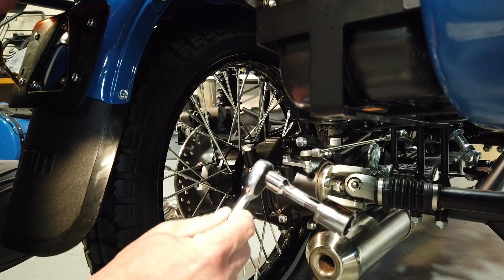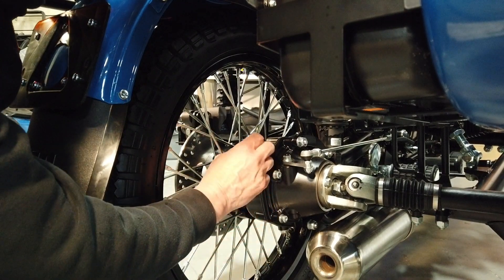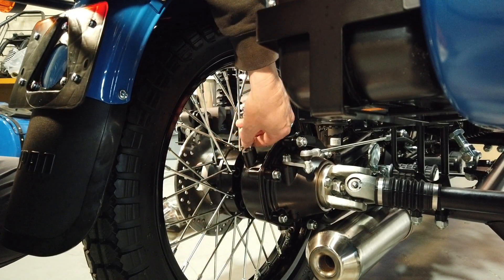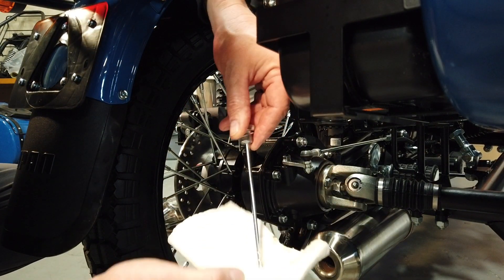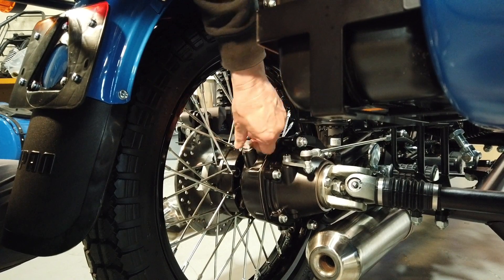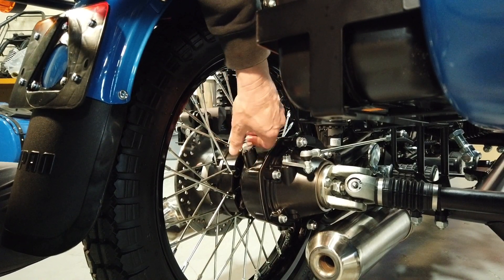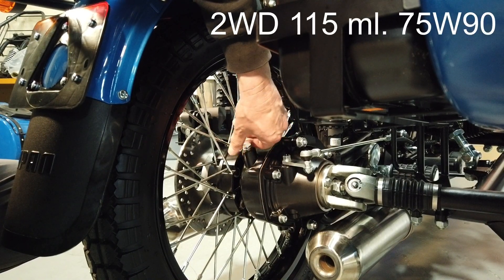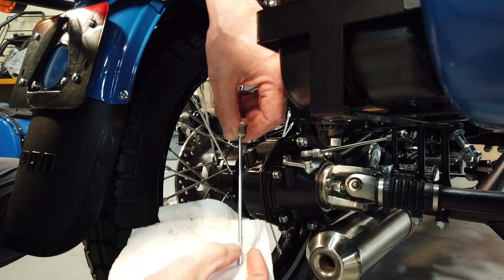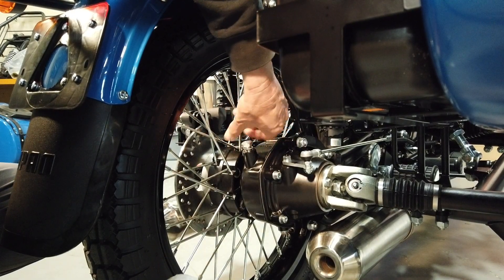For the final drive, you're going to need again a 19mm socket or a 19mm wrench. Break the dipstick loose and unscrew it, then check this on a cold final drive. If you have to dip it again, you've got to screw it all the way in and then all the way back out. A two-wheel drive takes 115 milliliters of 75W90, and a one-wheel drive takes 90 milliliters of 75W90. You're going to want this to be full up to the top mark. Put that back in, screw it in, and then snug it up.